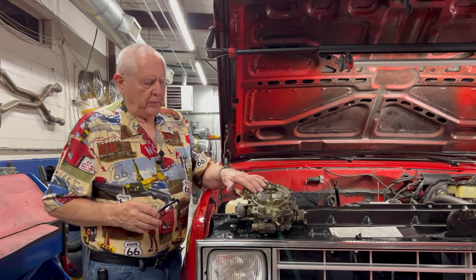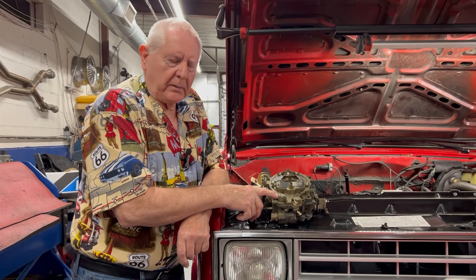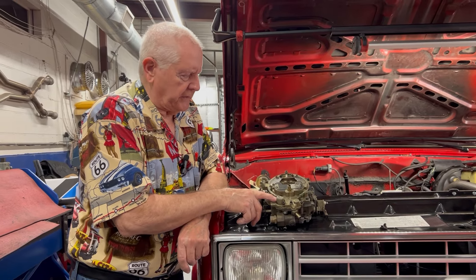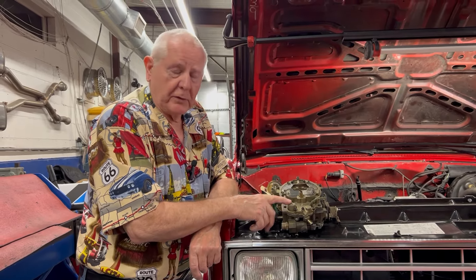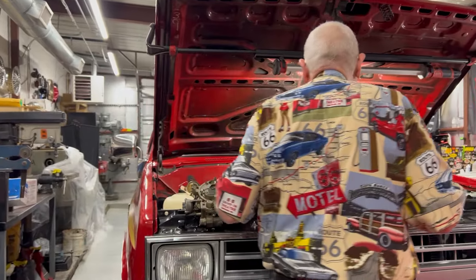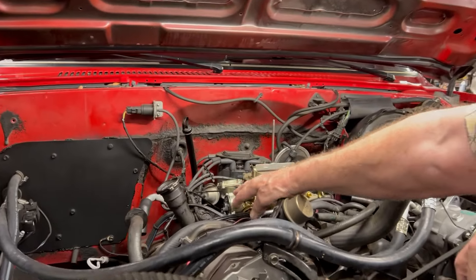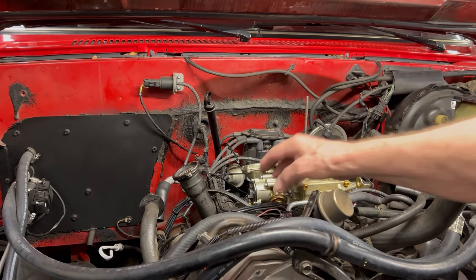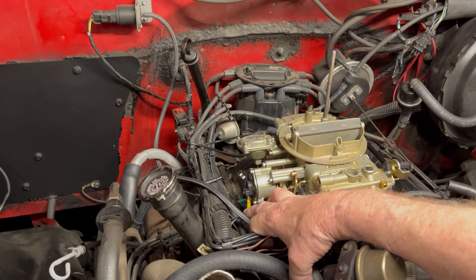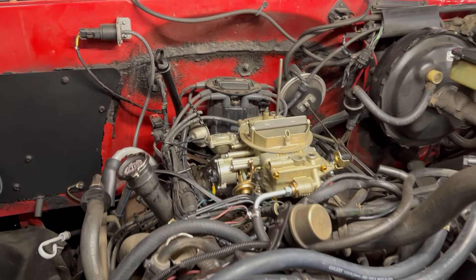So here's the old carburetor that was on there — it's an early electronic carburetor controlled by a computer. It had what's called an MC solenoid that tried to control the fuel mixture, which it did a very average job of at best. This one had quit working and we were still not getting enough fuel to the engine. So what we did was replace it with a brand new Holley four-barrel. When you buy one of these, get the electric choke — not the manual choke — it works so much better. Make sure you have 12 volts coming to the choke and make sure it's key-on so it's not running your battery down. We put that on there and that fixed it.